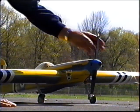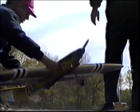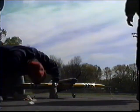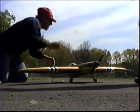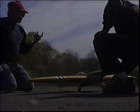Hey, spark plug, right? Joe, I think the props spun loose. No, something flew out the bottom. Don't turn it up. The fuel's coming out of it. Put it back down. Okay, the glow plug fell out. Yeah, I heard something go clunk. Yeah, I'm famous for that. Joe, I can't believe you did this. He did this with his new Spit. Oh, Danny, tighten up the glow plug. First thing I heard, I heard it start to slow down, and the prop must have hit the glow plug. When it came out, it ate the prop.